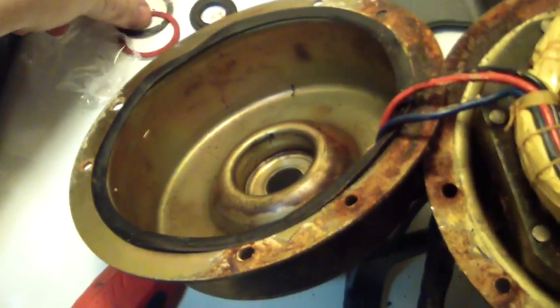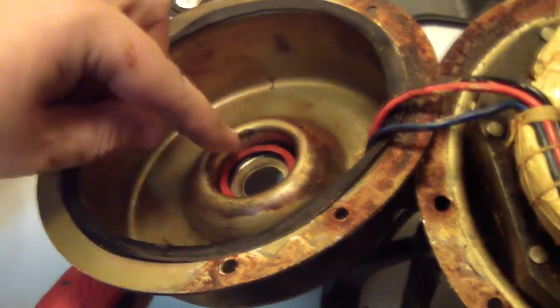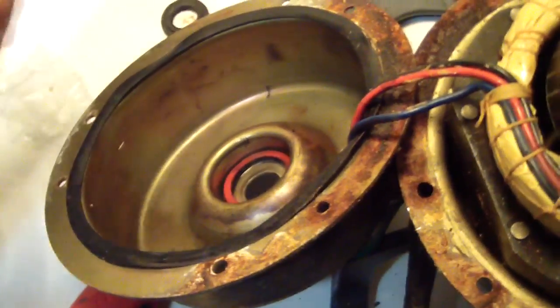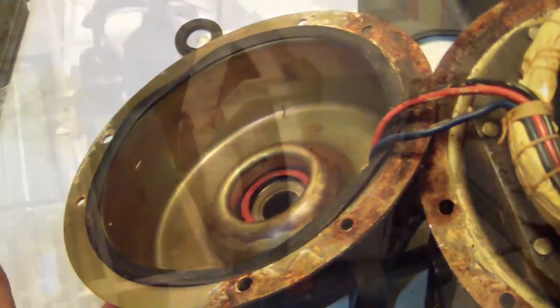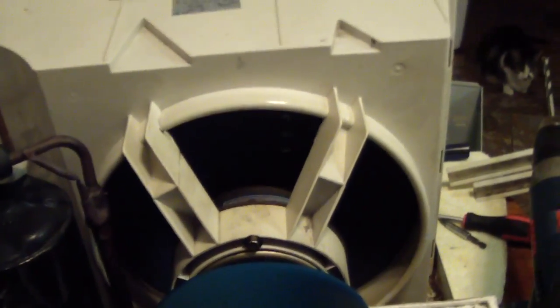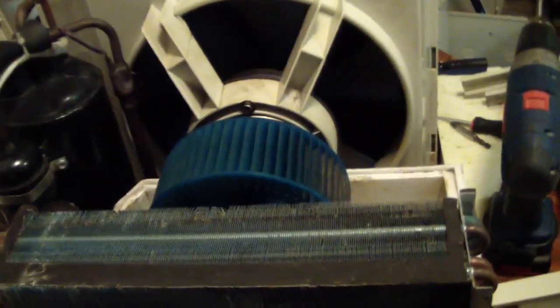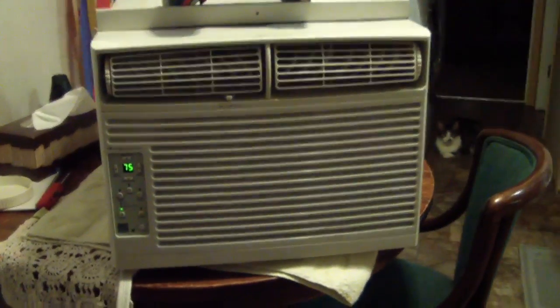Now I might be doing this part wrong or I might not. What I do is, before I put the bearing in, first I put the little spring in there, and then I put the little fiber plate in. I had them the other way and I think that might have been what was causing my problem. Then we drop our new bearing. And this is what she sounds like all put back together — nice and quiet. It's the way it ought to be. Partially put it back together just to test real quick — nice and quiet. Before it sounded like a meat grinder. And the final output at 10%: it's really nice and quiet as it should be. We've got air flow. No more meat grinding noise.